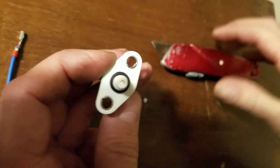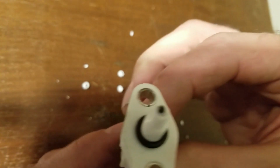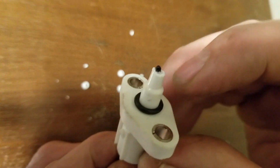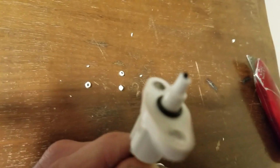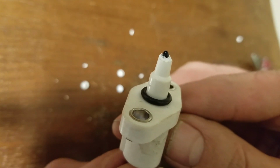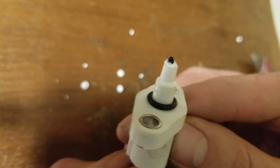I see you. There was dielectric grease on this thing. That was that white that was inside of it. And I just kept wiping it back and just plucking at this little by little until I got that little black button to stick out. And that's my resistor for my intake air temperature sender. So it's sticking out enough now to where this thing should read extremely fast, and that's what I need.